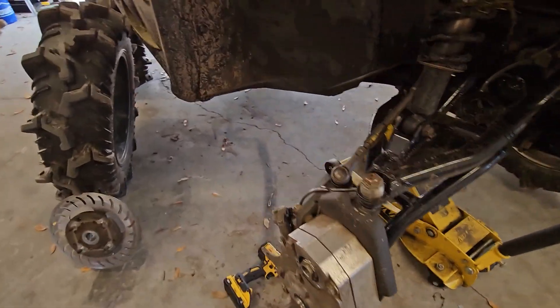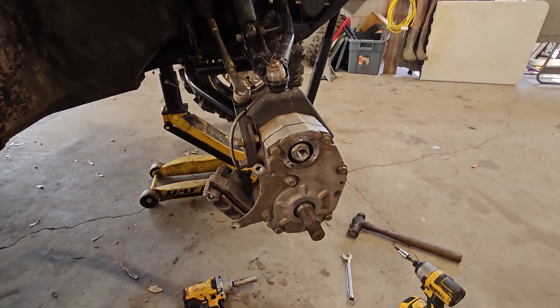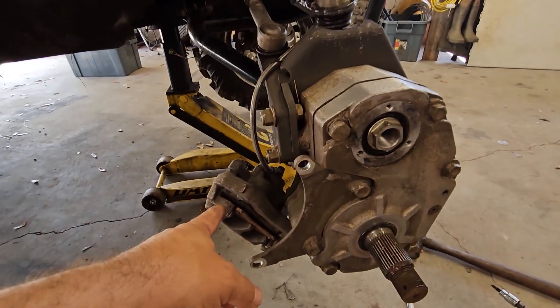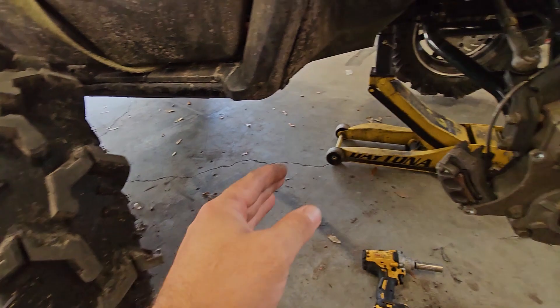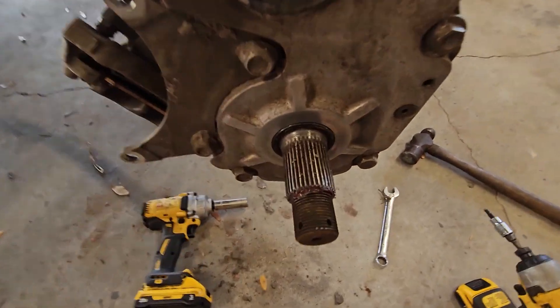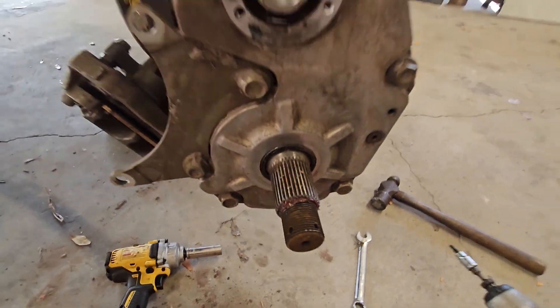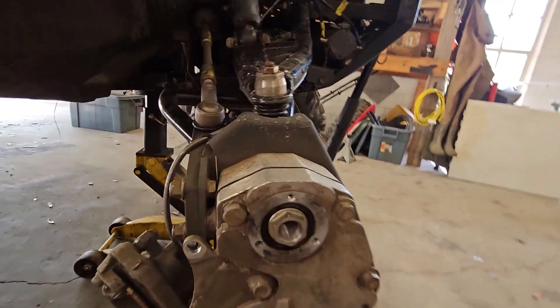So what do you have to remove to get the axle out? Because I have 6-inch portals, it's kind of a pain in the ass. With 8-inch portals this nut is high enough up that you don't have to remove all of this. So I had to remove the wheel first, then the caliper, and the rotor — which is this big nut down here. You can see a bunch of dirt fell on my shafts; I'm going to clean that real good before I put it in there, but it is still nice and greasy. That's key. I should have washed this before I started. And now we get to the axle nut.